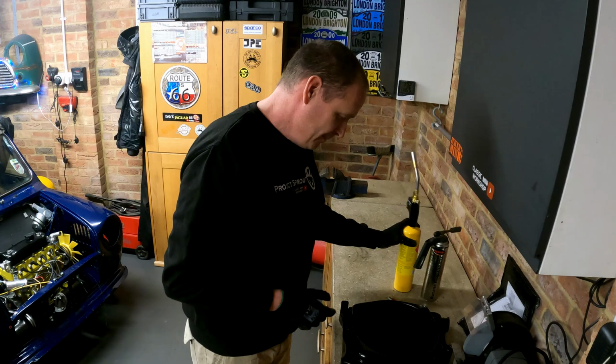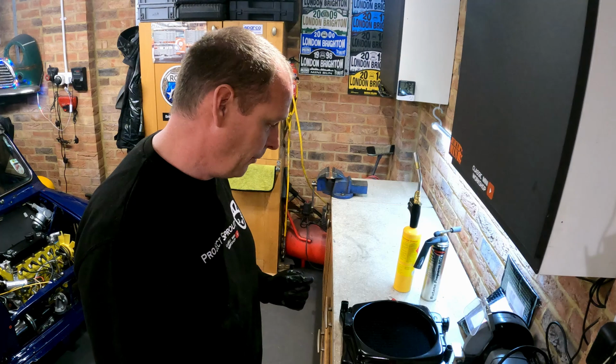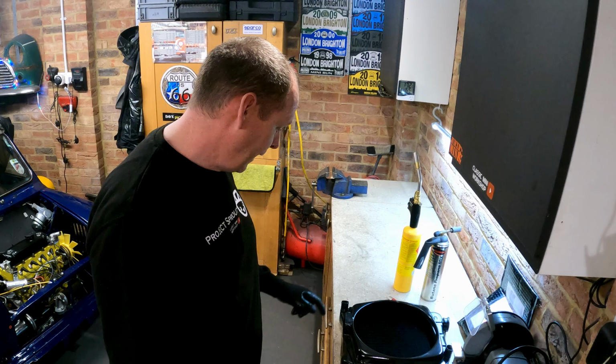Right, let's put some lights back on. Let's just put this radiator on, just for a bit of buttery shots. And I'm not gonna time lapse it. A radiator to put in is really easy. Bolt down the bottom there and put the top hoses on first, because that makes life a lot easier.